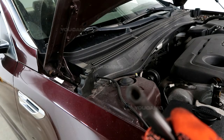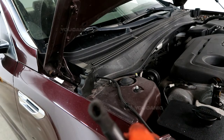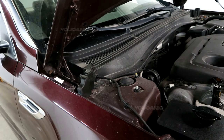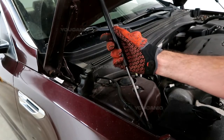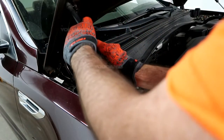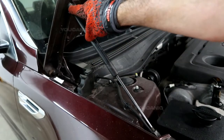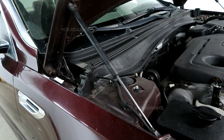There are some little tabs in there that hold it on. When you get your new one, just line it back up to the same orientation, put it on, and tap it into place — same thing with the bottom. It'll lock into place because those are spring clips that lock around the ball once it goes on.